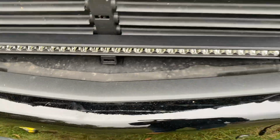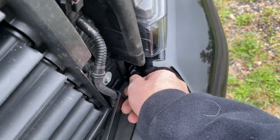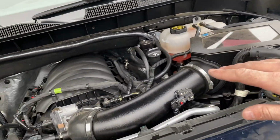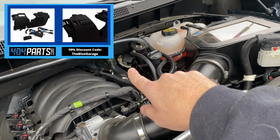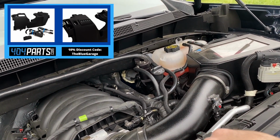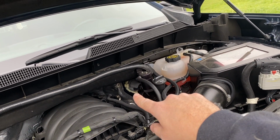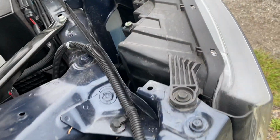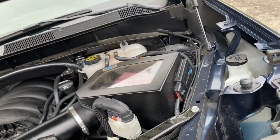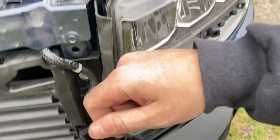So now what I need to do is I need to feed the power cord through. So I'm going to cut through down here, but instead of trying to fish it up through the headlight and then back around to that rubber fitting back there where I put in my Upfitter switches power cable, as you see I ran that around the JLT. If you look at my previous video from last week, you'll see my installation video for that. But I'm going to go in that same little hole down below. But in order to do that, I need to bring the power cable up behind the headlight and around the airbox and so on. Easiest way to do that for me, I think, is to fish a wire down first, connect them, and then pull it up through the top.